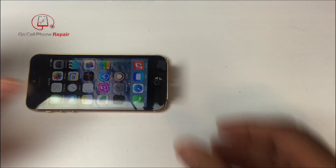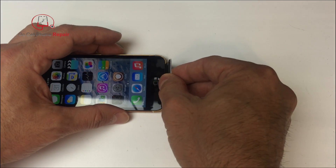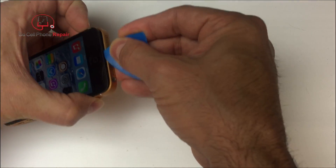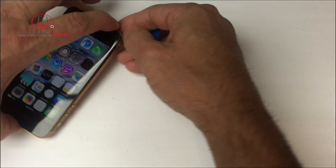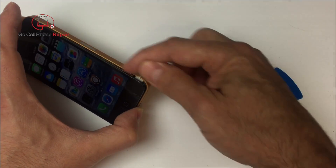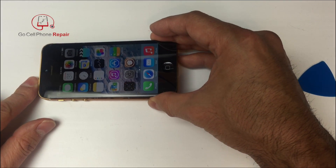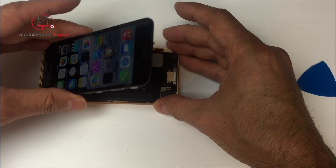Go down here just between the plastic and the metal — you can open this up with either a razor blade or a small suction cup to pull on the front of the phone. Just be careful; you want to make sure that you're getting the frame for the display separated from the housing. For more detailed instructions check out one of my disassembly videos for the iPhone 5 or 5c. You just need to pry up around this region, then pull the display away from the top end of the housing to give good clearance for the camera.